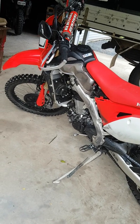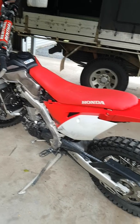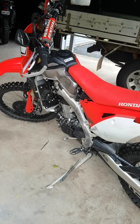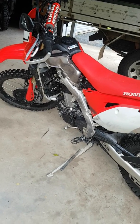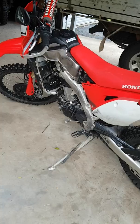The other thing I can tell you is that if you want to disable the speed limit or rev limit for this bike, you just need to solder in one 20 ohm resistor into the wire. It effectively makes the bike think that it's in fifth gear all the time. That's up to you.